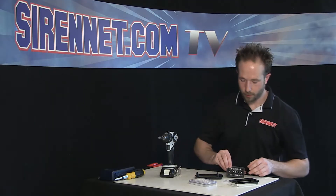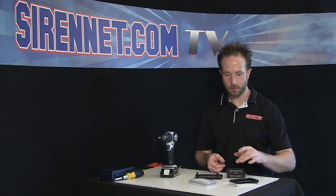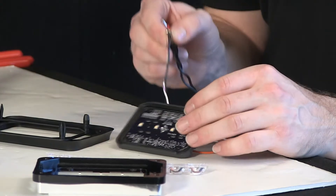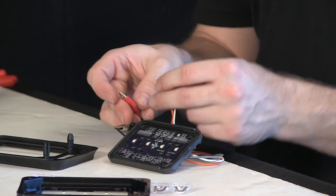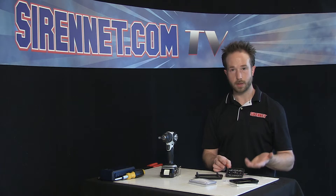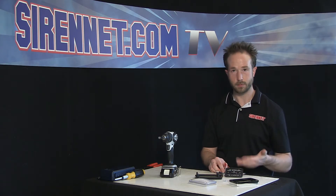What I can do is connect the pigtail on the back to a ground and to a 12-volt lead source, and I'll show you what the electronic array with the diodes looks like without any of the reflector or booster optics added on. The black trigger wire goes to ground, and because this is an amber 400 Series head, the lead wire is orange. If it was green it would be green, blue for blue, white for white, or a conventional red lead if it was a red light head. That's something Whelen likes to do to ID the color of their products when it's not on and flashing.